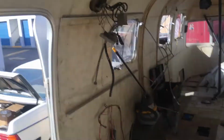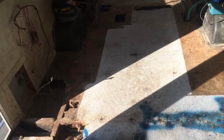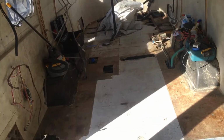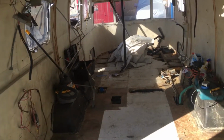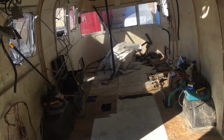So what you have is an Airstream which has rivets that attach the whole thing together, and basically tape or a sealer, a little rubber membrane that prevents the water from getting past the rivet, and it never does. I guarantee you, 99% of the Airstreams that are over, let's just say, hypothetically, a year or two old, start developing rivet leaking or joint leaking potentiality, okay? Given.